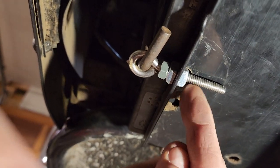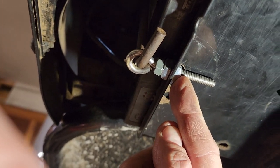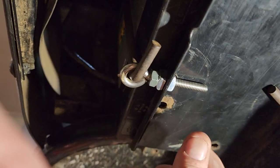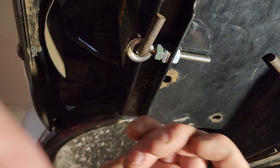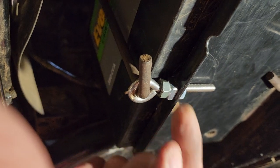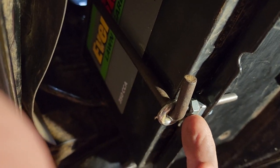What you need to do is use these little square nuts. If you take the square nut and angle the point up into the bottom of that tray, it allows this quarter-20 bolt to lay flat so that it's not angled down towards the ground. Anything bigger — as far as a nut or bolt diameter — is going to try to angle the whole thing down. This allows it to lay flat. On both sides I used the quarter-20 square nuts, then put another nut to use as a jam nut.